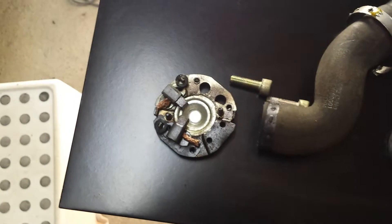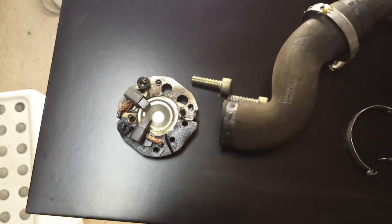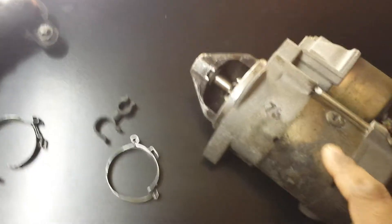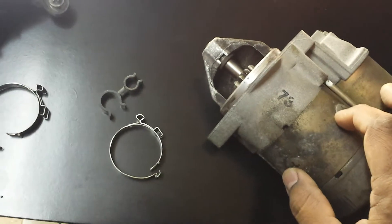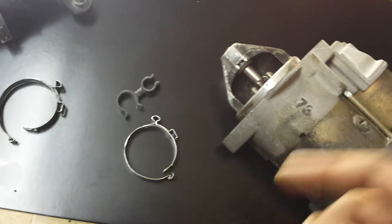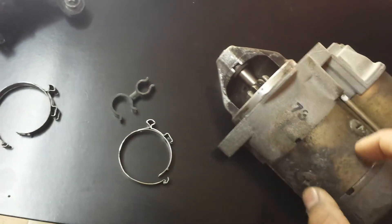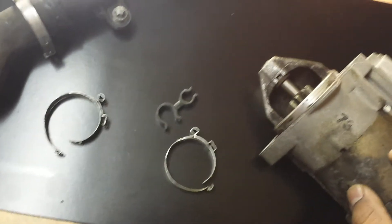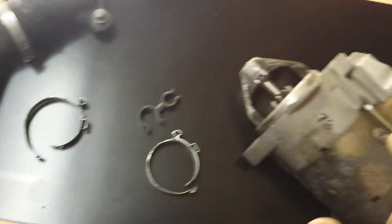That short circuit was overheating the whole motor from the inside, which was causing the smoke I could detect in the car. You could fix this quite easily by just replacing the carbon connector unit, but what happened is it had been overheating for so long that inside the actual coils on both sides — the coils that create the magnetism for the motor to crank — they had a lot of carbon buildup. I've taken some pictures which I'll post on the website.